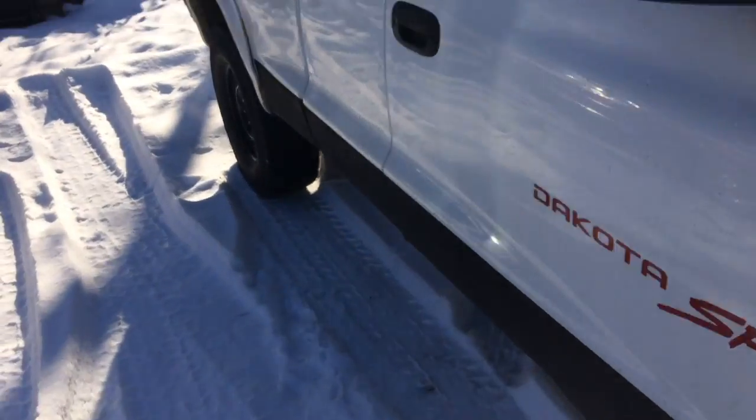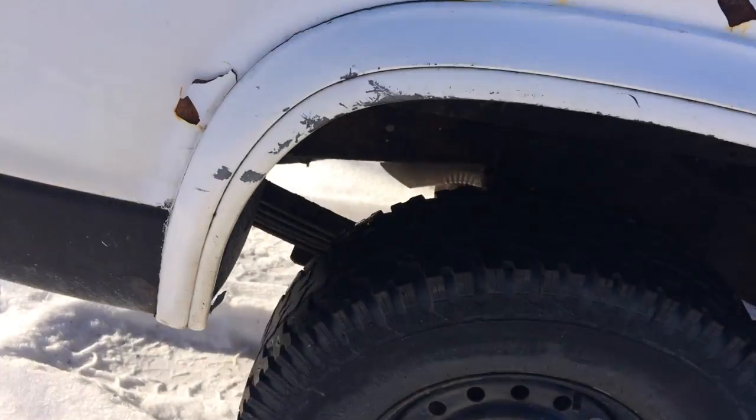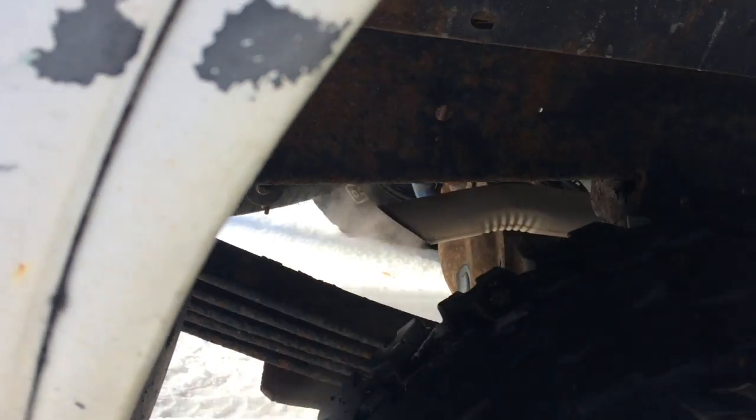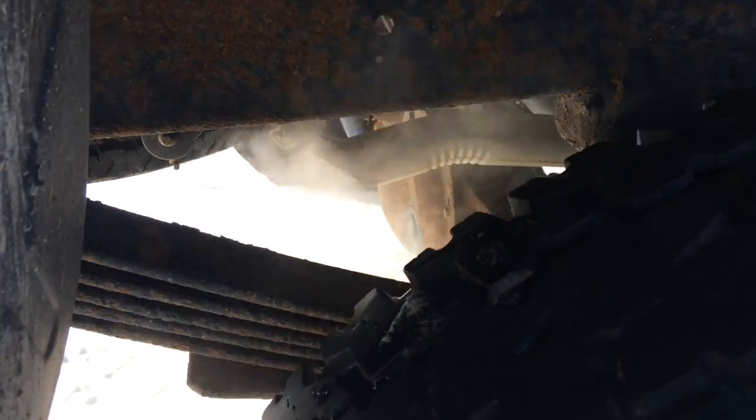Anyway, next thing you're going to want to look at, exhaust smoke. Now, this thing's kind of difficult to try and comprehend if it is doing anything awful, because the exhaust pipe is tucked in way behind there. So I usually just rev it up, and if you notice odd smoke, either burning oil or burning too rich or any of that nature, or white smoke altogether, then chances are you're not going to want to skip this one. You're going to want to walk away from it as far as possible.